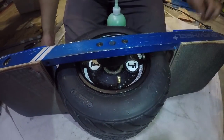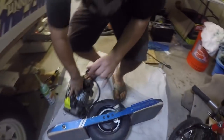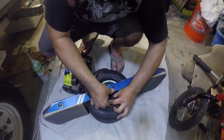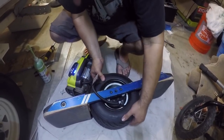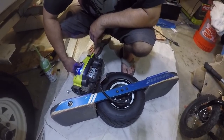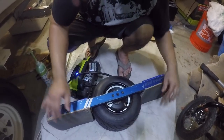Let's pump it up. On your Vega you normally rode 21 to 23 PSI — let's start you off at about 18 and see how it feels. I normally ride this particular tire at about 21.5 PSI. Let's set it to 18 — got 17, then 17.5, then 18.5. Okay good — take it out and go ahead and take it for a test spin. 18.5 PSI — let's ride!